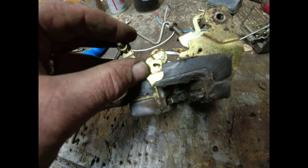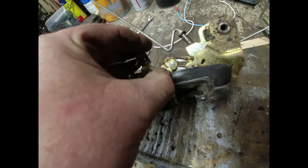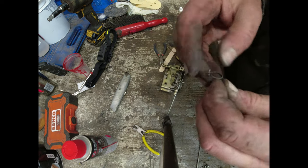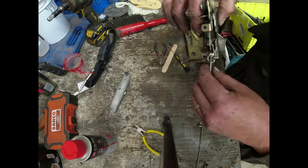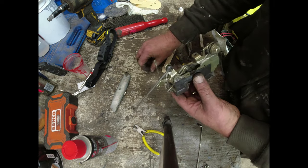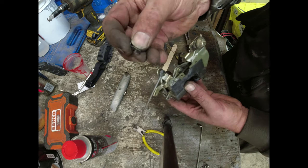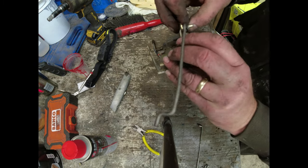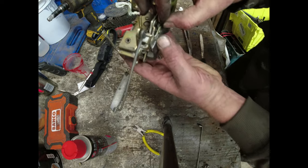I've just taken a little bit of the rubber insulation piece off and you can see the end of the spring there, and the other end of the spring is on the other piece there. You need two lugs and it goes in here on the lock side - see how floppy that all is. I find it easiest to put it onto the moving part first and foremost. You kind of have to twizzle it around a little bit to get it into the hole because you've got a dog leg. It's a lot easier putting it on than it was getting it off.